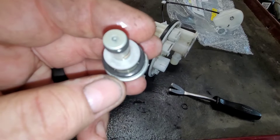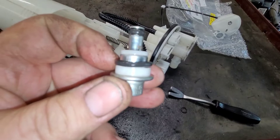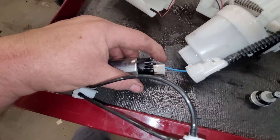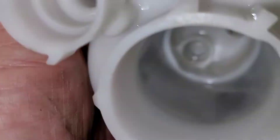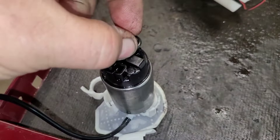You can actually see how distorted that seal is right there. I'm going to have to get some O-rings that'll work with this. When this goes back together, this collar goes there and then this O-ring goes on top. What happens is that collar holds the O-ring in that spot and that inserts into that area. The funny thing is somebody had it backwards — they had the seal down here with the collar on. That's not how it goes; it goes the other way around.